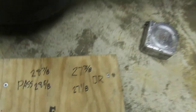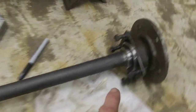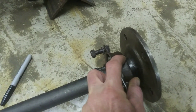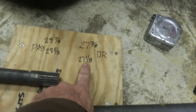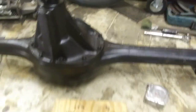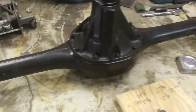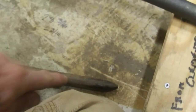I made a mark on the stake right at the end of the housing and measured it — 27 and 3/8 inches. I cut a quarter inch off my axles. Then I hooked the tape measure on the bearing retainer, tight against the bearing like it would tighten up onto the housing, and measured to my cut — 27 and 1/8 inches. So it's a quarter inch shorter, which means if it were a quarter inch longer it would be dead bottoming out inside the posi. Thanks to Don and Brent for that info.